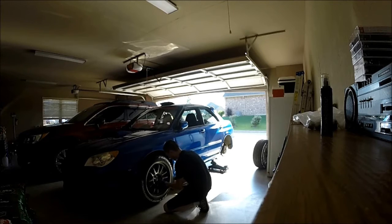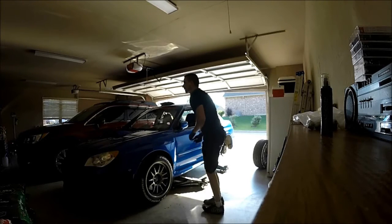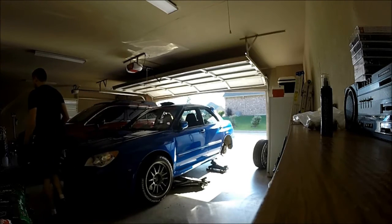I kind of go through it once or twice hand-tightening with the adapter, just trying to get it as flush with the hub as possible — as opposed to just hand tight. You want to draw the wheel to the car and get it as flush and snug as possible.